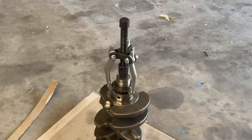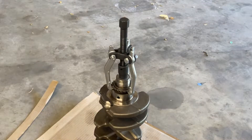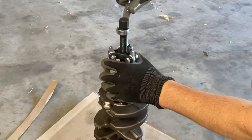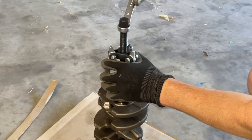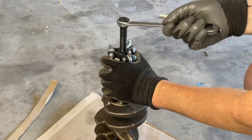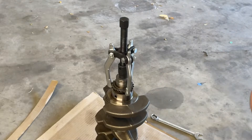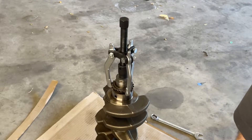First we're going to get the old oil drive gear off. You see my setup here with a three jaw puller and I'm using an impact socket to fit into the snout. I'm going to tighten it up first by hand while holding it, then we're going to hit with the impact tool. This took me three attempts, but each time it moved a little bit, and this is my third try where it fully came off.